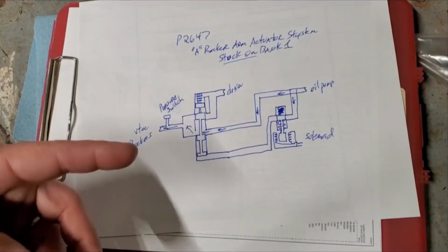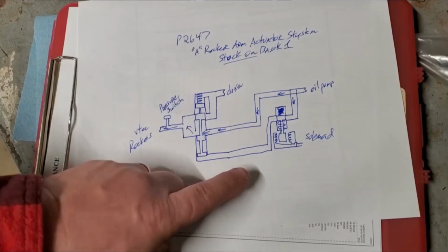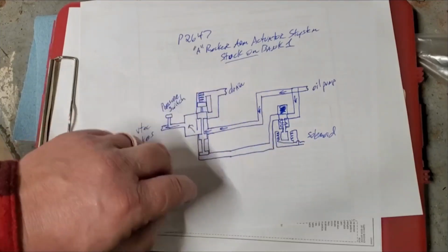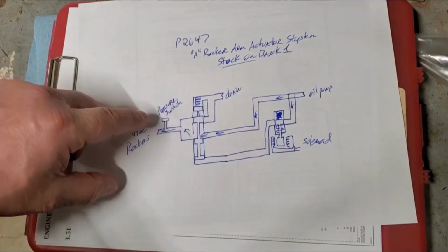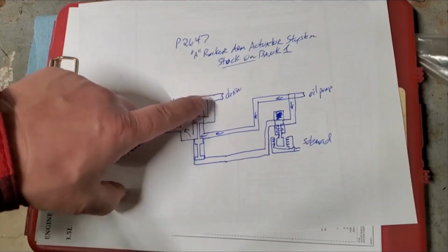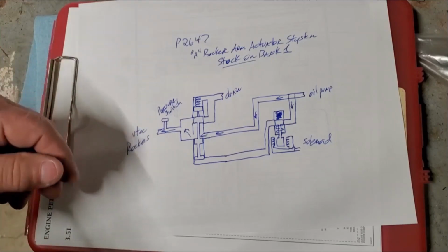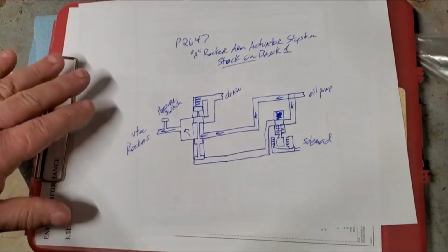So that also made me think, what's the difference between the two? If you're cruising down the road at normal operating temperature, your solenoid is de-energized. Now you're sitting at part throttle a little longer and it goes into eco mode. Give it a few seconds, you'll see that solenoid energize. Then you should see this pressure start rocketing off because you're closing that valve and sending your VTEC oil pressure back to the drain. It modulates somewhat and it's pretty smooth acting, so I'm glad because it's a little less violent, and my wife doesn't hear me getting in the throttle so quick, so hard. I hope this helps on this.